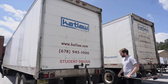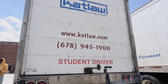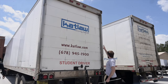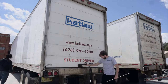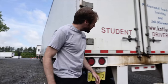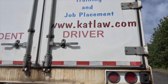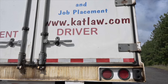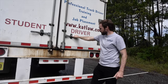Standing at the rear of the trailer now, I'm going to look at my door. If we have a roll-up door, it's going to be securely mounted, not cracked, bent or broken and there's no missing hardware. The seal is in place and it's not cracked. Door opens, closes and latches from the outside — you do not have to demonstrate this. For a hinged door, we want to check the door tie — securely mounted, no missing hardware and not broken. The doors and hinges are securely mounted, have no missing hardware, not cracked, damaged or bent. It opens, closes and latches properly from the outside. The door seals are in good condition with no dry rot or damage.